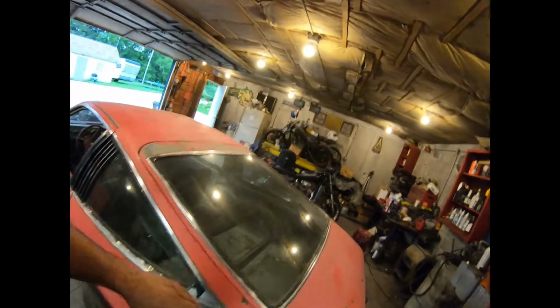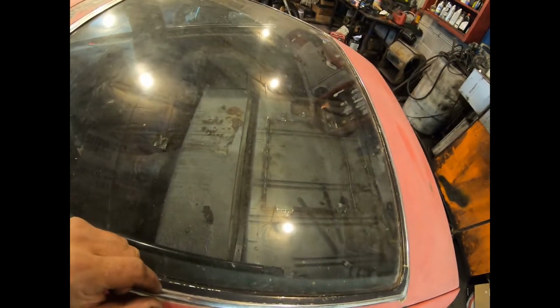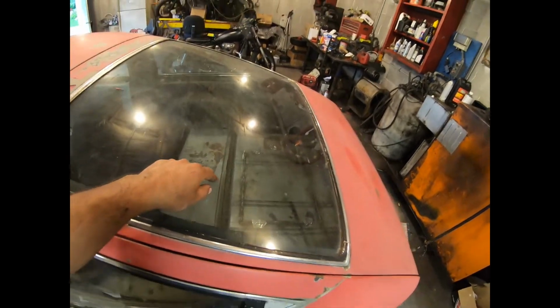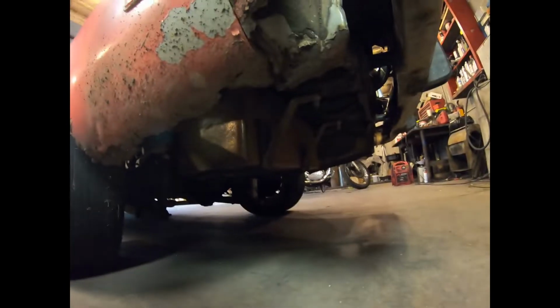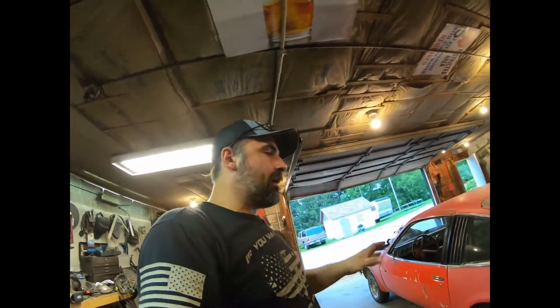Oh, that's one other thing too, if you guys remember from the other video, if you can see through the window, the patch is welded back in where that basically lawnmower fuel cell was sticking up into the car, all welded back in, sealed up, and I did build a steel tank, a temporary steel tank underneath here. You can see my crude straps and everything. I think it's about 11 gallons. And got all that put in here.